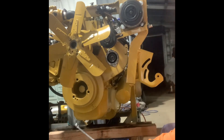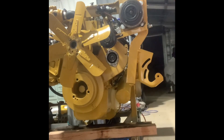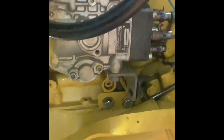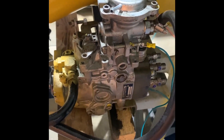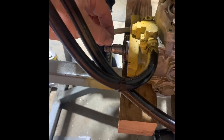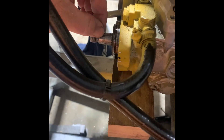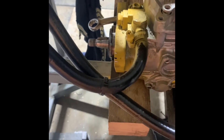I've got a bolt in the way. I've just got the lower mount of the injection pump moved out of the way and that'll just fall out, so we'll give that a go. You can see I've got the injection pump out - once I removed that little rear bracket there was nothing in the way and it just fell straight out. You can see here we've got our little spindle shaft with our little shear pin slash disc, and that's moving around quite freely. It didn't fall into the timing case cover, so that's awesome.